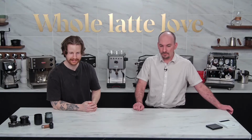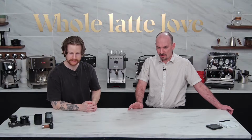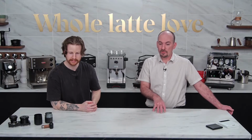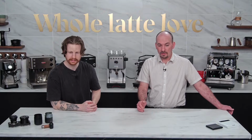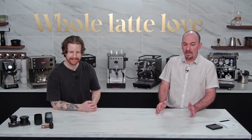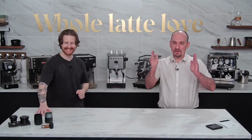Steam valve half for 5 seconds, then steam valve full turn at 5 seconds, turn on steam, so you're raising the temperature just a little bit, turn off brew switch, so you're stopping, okay. Turn off steam, wait for the light to come on, close steam wand, then, okay, so you're really going all out then, Mike. Next time, space them all out.